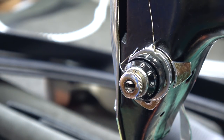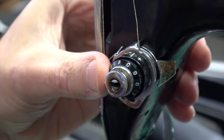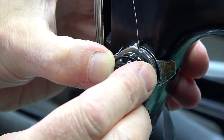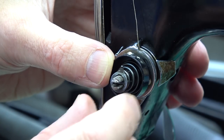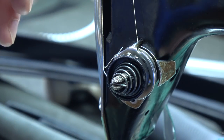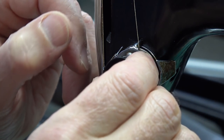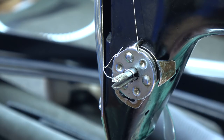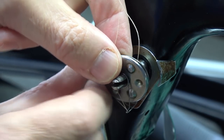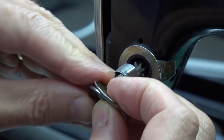First thing to do is to turn your machine off. The order is: hold the components, push the number dial ring back in, and take the bits off one by one. So that's the adjusting screw, there's a number dial ring, there's a little finger washer that has a tiny finger on it pointing forward, a beehive spring — aptly named, it looks a bit like a beehive — and then another cup washer with a plus and minus on it. Then you've got your tension discs and holders — pull all of those out. Out comes one arm of your spring and then out comes the spring itself.